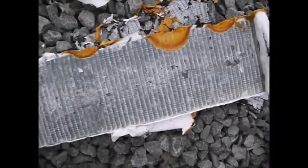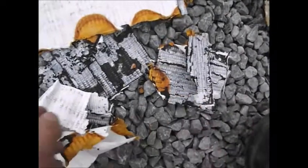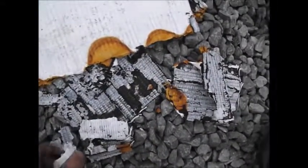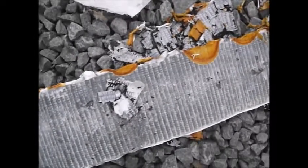And there's the lead side, and then the back side of that is your lead paste. So one's your negative and one's your positive. It's all dry because the battery's old and it's no longer any good. So I just want to show everybody what these things look like on the inside — and basically that's what your AGM battery looks like on the inside, even in your square type batteries. This is the matting you have in between the plates, and here's your paste, and then that's the lead itself.